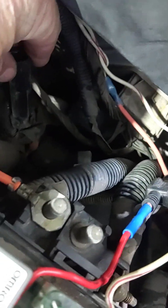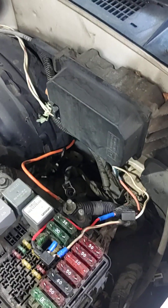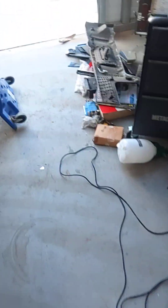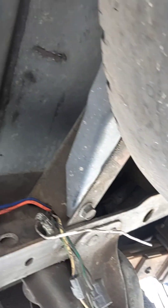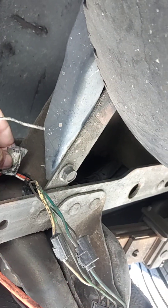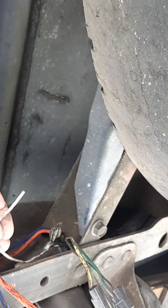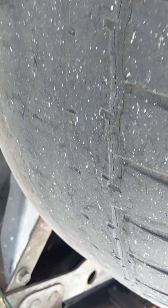There's also another wire that is tied back. It has a plug on it — it's right here. It's a white wire, and I'm fairly certain that is the other wire coming out at the end of the truck. If you get underneath your truck and go to the back, up next to your spare tire where your harness comes out, I found that blue and orange wire tied back, and I also found this white wire. It's got a tag on it that says BRK. I'm going to assume that's a brake light wire, but I don't know yet — I haven't messed with it and I'm probably not going to use it.